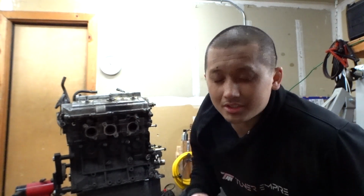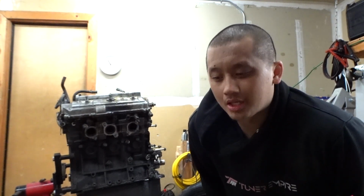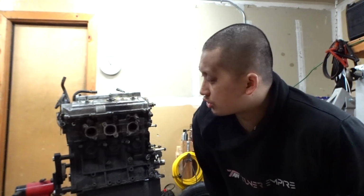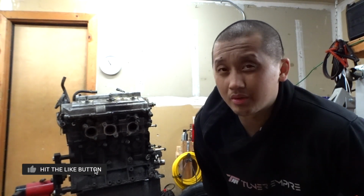I skipped out on yesterday, didn't film anything yesterday, but yesterday I got my 3.4 motor, my 5VZ-FE, picked it up from another Toyota gearhead, and I got all the parts that are needed to do the swap. I didn't film anything yesterday because I'm on such a time crunch, and today I didn't film anything at all, but I got it pretty much stripped down to the valve covers. I took off the timing belt, got everything open already, removed the cams and all that stuff. It's super oily and dirty because it had a lot of oil leaks.